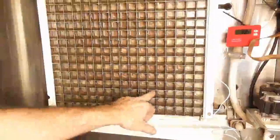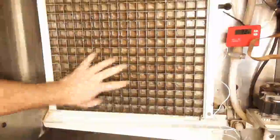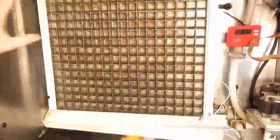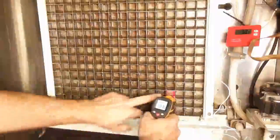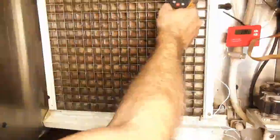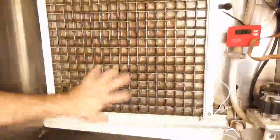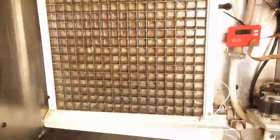The machine has been running and I'm starting to see ice forming. It's obviously going to start here first and gradually ice up. It won't be as quick because our face plate is off, so we're getting a lot of heat transfer. Taking my thermometer — we're seeing negative 4 degrees Celsius and around negative 1. As long as we're in the negatives, ice is going to start forming at sub-zero temperatures. I'm pretty happy with this — it doesn't look like it's going to need any gas or refrigerant.